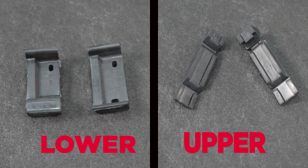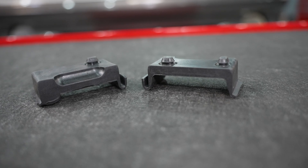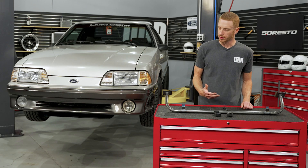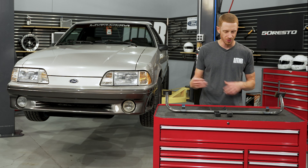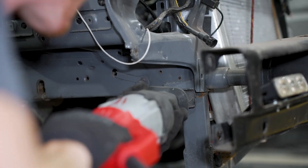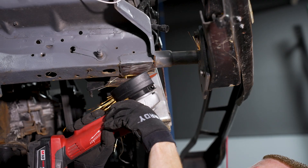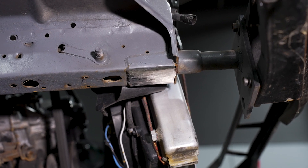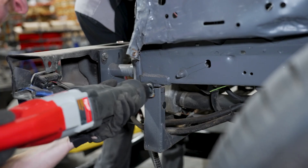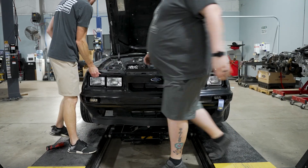The actual lower insulators are the fatter or less skinny insulator. There's no real set position since this isn't a factory application, but you will need to cut the locating pegs or dowels from the backside of the insulator. For any additional fitment notes, always reference the product page. There's really no torque specs involved with this, but I will leave a list of tools down in the description. You're going to need a decent selection — obviously something to remove spot welds and cut the factory section of the core support out, and then you'll also need a welder to weld this into place. I would at least have assistance from a friend because the extra hands will come in handy.